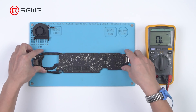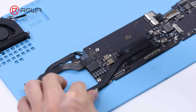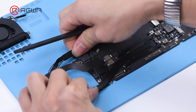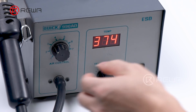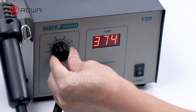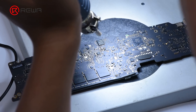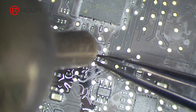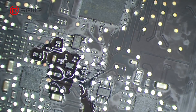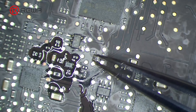The normal resistance should be 0 ohms. Then we replace the R2072 resistor. Remove the connecting flex cable and CPU radiator. Set the hot air gun airflow to 4 and temperature to 430 degrees Celsius. Apply solder flux and remove R2072. Put back the new 0 ohm resistor.